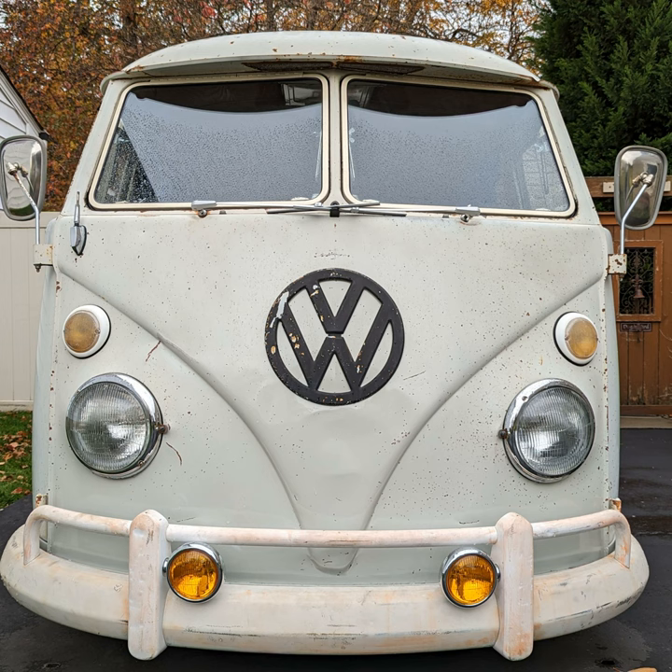All I had to do was mount up the new fog lights, and I decided that the location I liked best was inside the front bumperettes, midway vertically between the bumper and the front towel rack. After looking at a few mounting options, including some that mount to the towel rack, I simply elected to drill the mounting holes onto the side of the upright bumper bracket and hang the light from the side, then clock the lens so the lights were correctly oriented. You can clearly see them mounted in my podcast icon. I felt this minimized any large brackets or bolts visible on the front bumper.